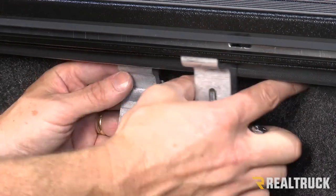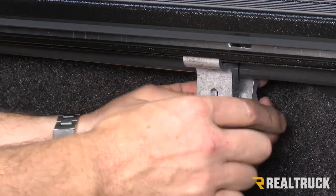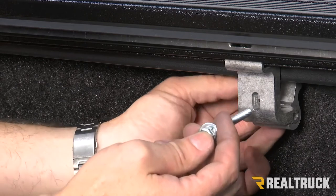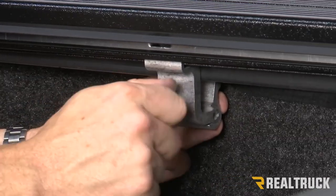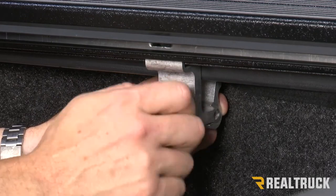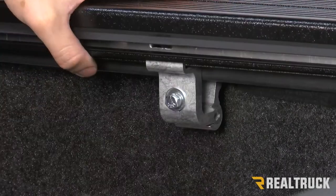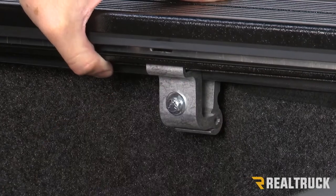For the rear clamp, we've got a little bit of clamping area in here. We're going to find a good spot to slide this in as close to the tailgate as possible. Once we get into that location, we put this clamp together pretty much the exact same way we did the front clamp, except we're going to use the shorter bolt along with the barrel nut on this one. We use bolt, lock washer, and flat washer, and tighten it down with a 7/16ths. As we tighten that down, the clamp pulls the rail towards the bed cap and also down to the bed cap at the same time. We're going to repeat the same process on the opposite rail.